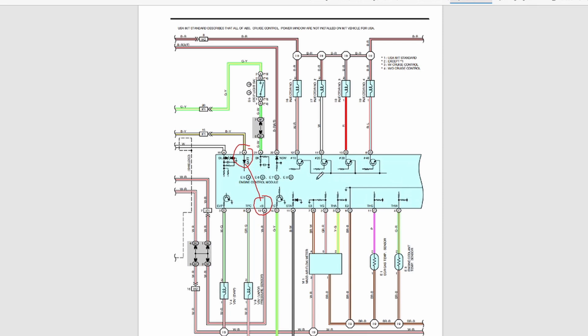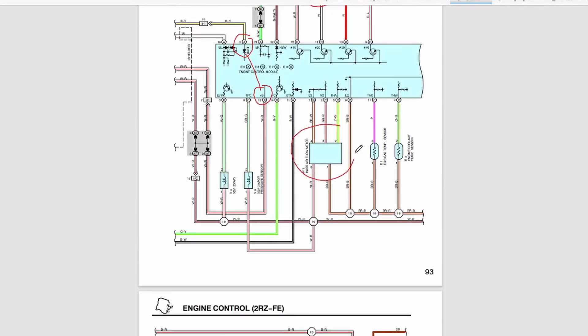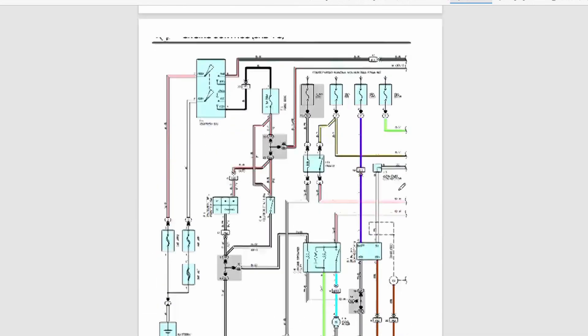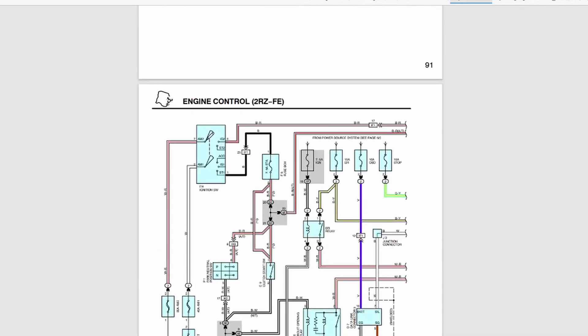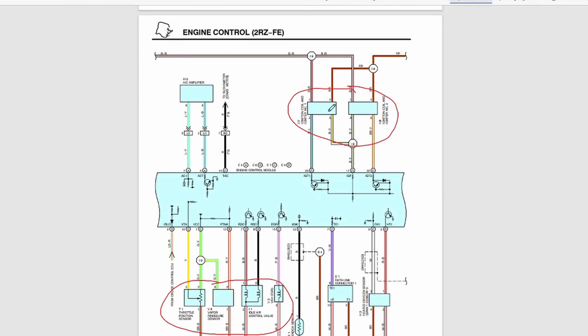Now that your ECM has power and turns on when the key is switched, we need to figure out what other electronics need power. Generally speaking, you need to give the injectors power, your igniters and coils power, your throttle position sensor, idle air control valve, and mass airflow. Finding the source of these powers is pretty straightforward. You can see the injectors here — follow the wire up and over to the other page, and you can see it is on an ignition switch circuit. So the injectors get switched power through the 1K2 plug. That same black and red wire in the 1K2 plug also powers your ignition coils and igniters. Once those have switched power, that circuit is done.